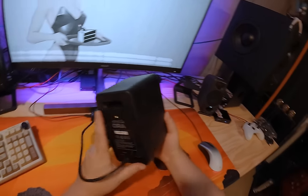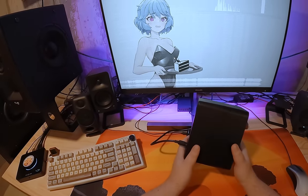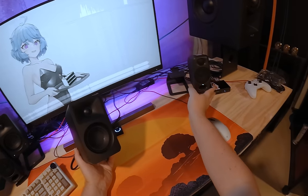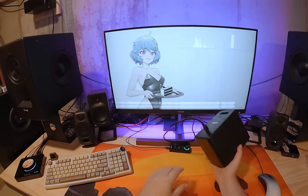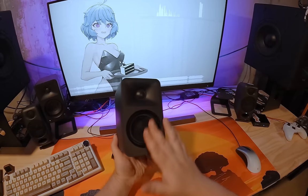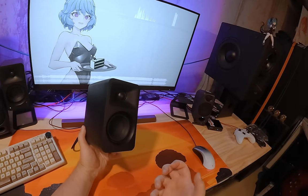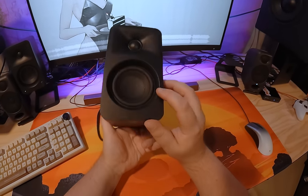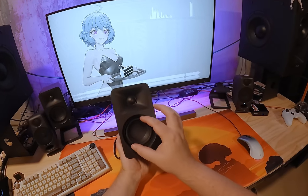Very light little babies with a little tiny port. These have a port in the front; these have a little port in the back. They also have a quarter-twenty mount port in the back. The speaker-in and speaker-out connections are labeled, though the placement forces a particular side orientation. Look at that waveguide — it looks like a little JBL LSR with a three-inch driver, very deep set. That's done purposefully. They are trying to guide the sound out of that three-inch with a little tiny waveguide of its own.